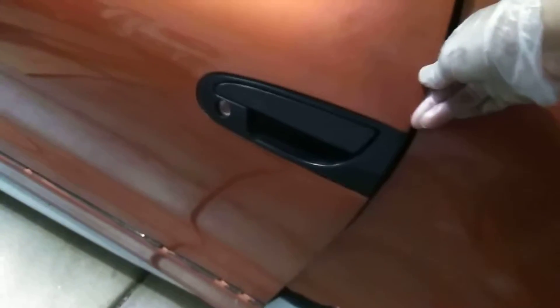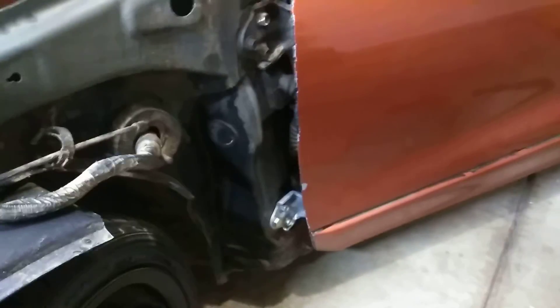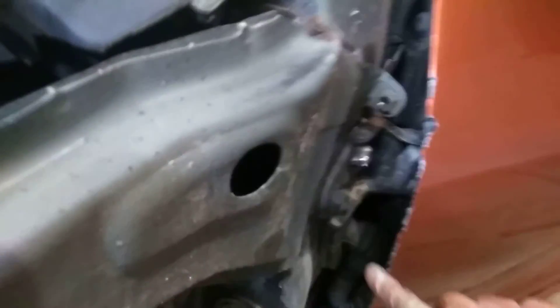He broke the door handle off — I haven't pulled it apart yet. We all know these are notorious for breaking, but let me get down in there and see if maybe a rod is just detached, because I know these door handles pretty well. Let me show you what my door does — first thing when I open it, it drops down. So I've got to do some adjustment here. When you're opening the door, the reason we took the fender off is it was scratching the fender. It's an old car, '97. Even if I try to put the fender back on, it's scratching here — the door is too close to the fender, so I'm going to try to figure out how I can adjust that.